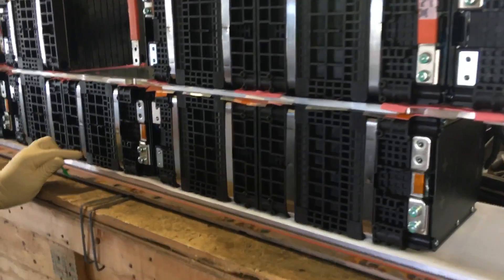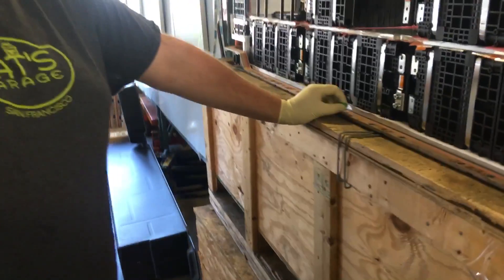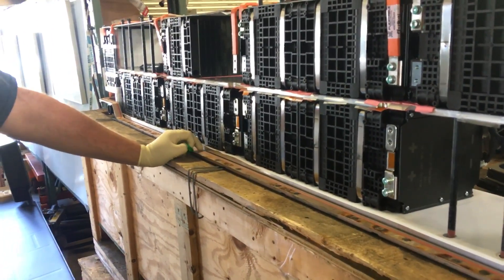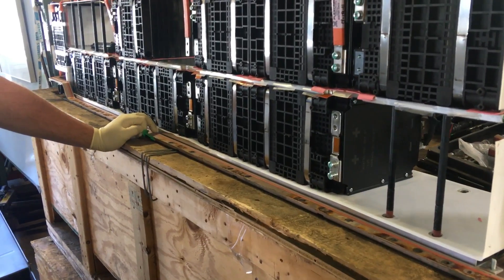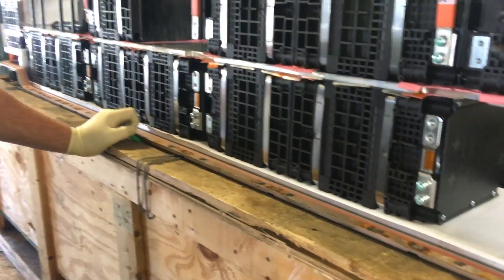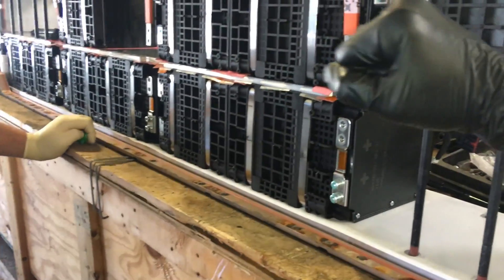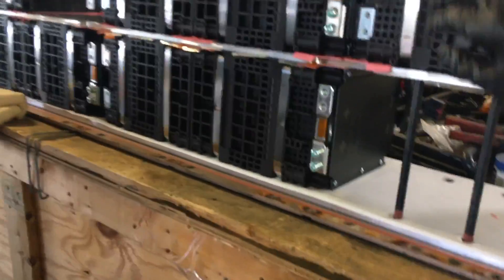That's why it doesn't have a radiator — just a heat exchanger — and we've never seen issues even with the AC system non-functioning. One Fisker in Fresno had an AC line rubbed through, so the AC system hadn't been working for three years. He drove it every day in 100-plus degree heat with no problems other than a check engine light for the AC. They replaced the pipe and three years later he's had no issues with the battery.